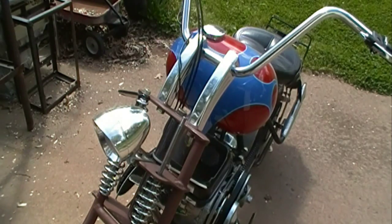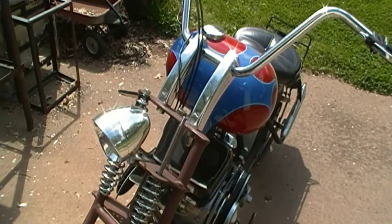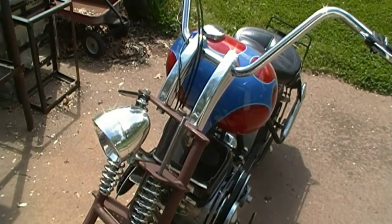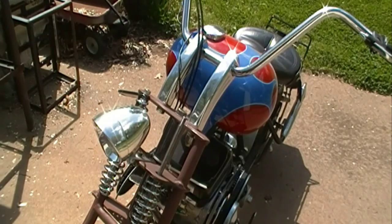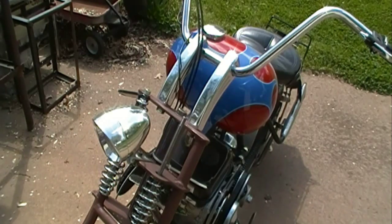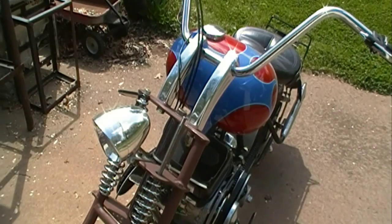I could get my Dremel and sit here and whittle away at it, and I may try that. The chances are it's going to take too much material removing. We're talking about 20 thousandths. And I just don't know. This is bronze. It's hard, man. A little piece of sandpaper on a Dremel will take forever. I only have the one little sandpaper bit that will fit on this, and I just don't believe it'll do it.